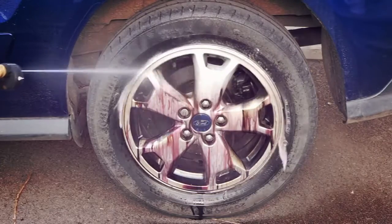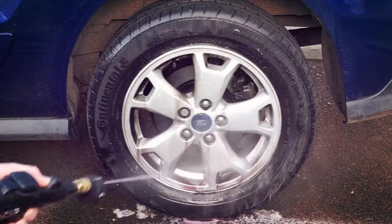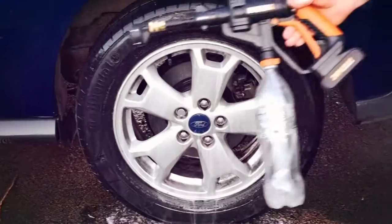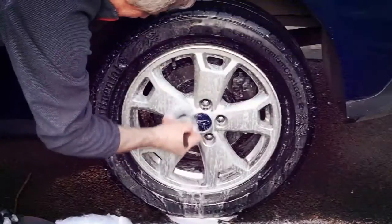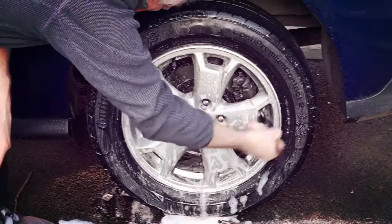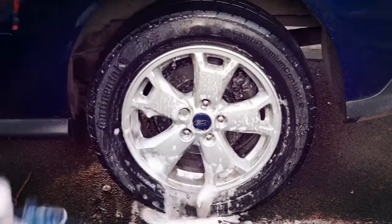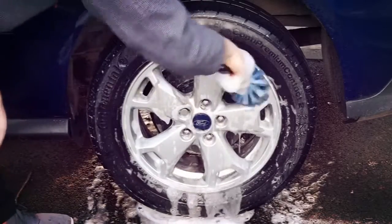We're going to let them dwell until they go a nice purple colour. Then you can get your HydraShot and clean off the wheels. Once you've done that, you want to get your snow foam attachment and spray your wheel over with snow foam — this just makes great lubrication. Now you want to get yourself a very small brush. You can get these detailing brushes off eBay or Amazon, and this is the best thing for doing your wheels, especially the smaller areas. You can then use your bigger ones to get into the back of the wheel and right behind the back of those spokes. I will share the link in the description for the brushes.